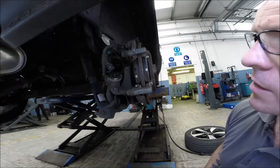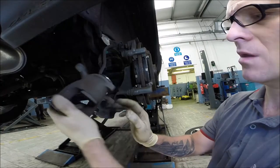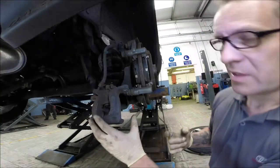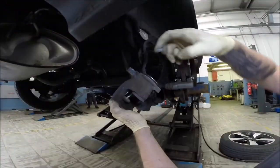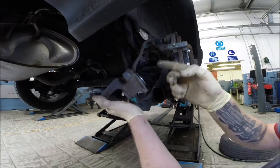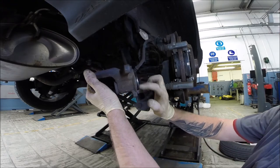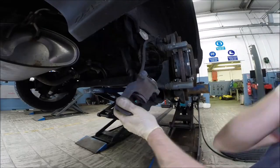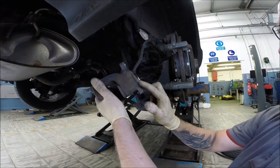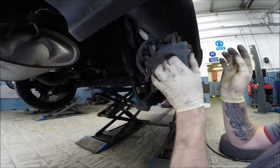Well, so time for caliper. You can add some grease here around. The best idea will be to use the Vaseline. This will keep water away from here. Vaseline 100%, I think. Nothing destroyed here. Okay, lovely. And we can fit now.